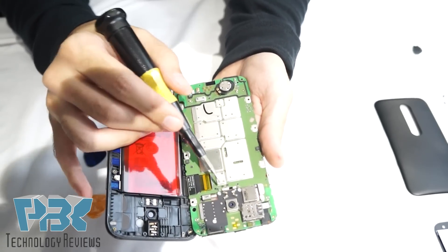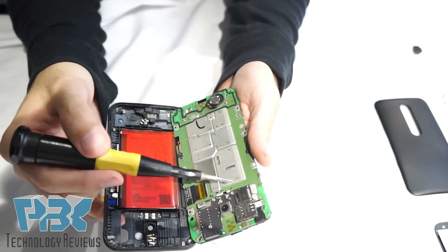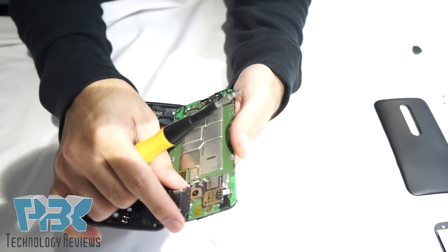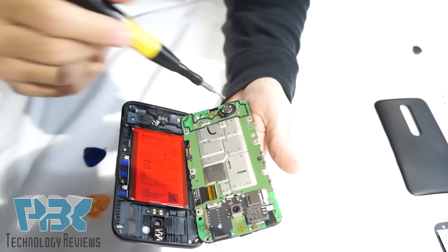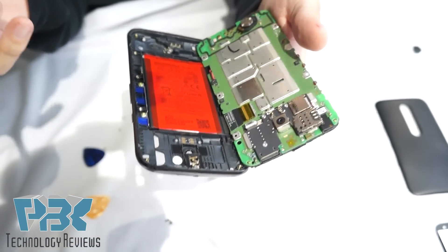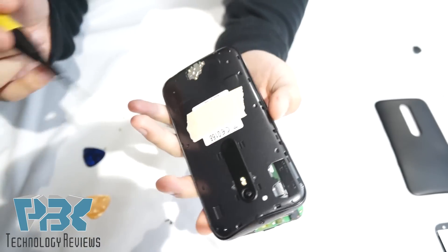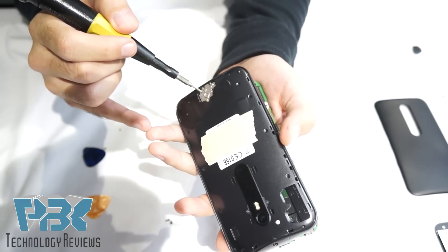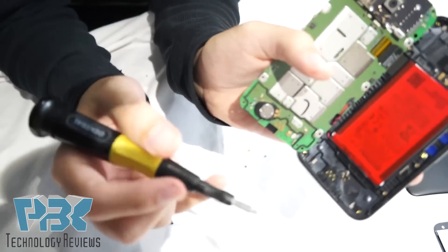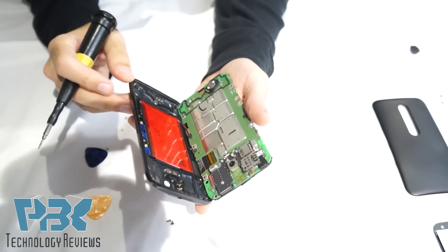You have your main camera here and your front-facing camera attached to the board right here. You can replace the piece which holds your SIM card and memory card reader — there are three screws to remove and you can take that small board piece off. You've got your main speaker down here. And it looks like you can replace your charger port even without fully disassembling the phone. So if your charger port goes bad, breaks the pins, or stops working, from the back once you take those screws off you just pry off the charger port — it comes right off. From the inside it's just a couple of contacts touching the main board, so that's pretty convenient.